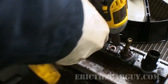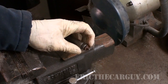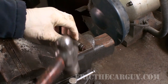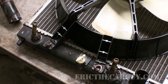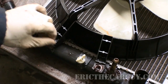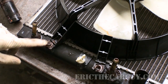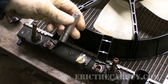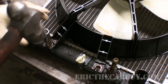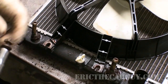Push down hard. It broke, but it came out — doesn't matter. Here's a little tip: if it gets stuck in my socket, I'll just take this and put it on the anvil and hit it with a hammer — that's all it usually takes. For the second one, I'm going to get a 3/8 socket and hammer it on here — sometimes just putting a smaller socket on is all it takes. Came out — we're free.